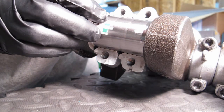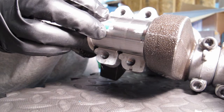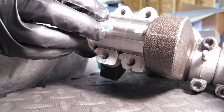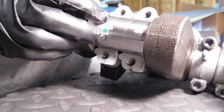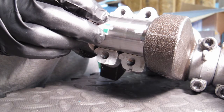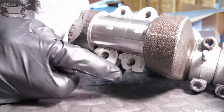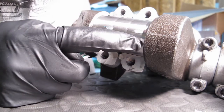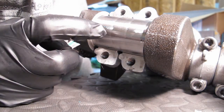But the first one is a little bit on the thin side. It looks like it's thicker — yeah, it looks more close to .001, but a little less. So it's better than it was before and it's just right on the margin. Really, really close. Which would explain why this one was spinning more freely on the lubrication test than this one.